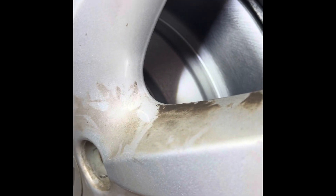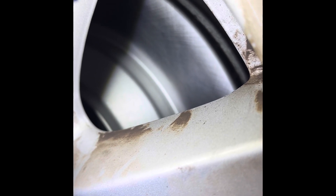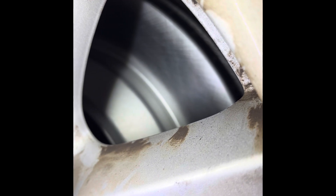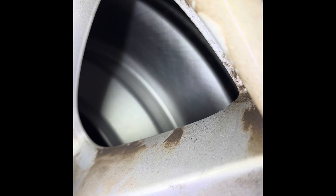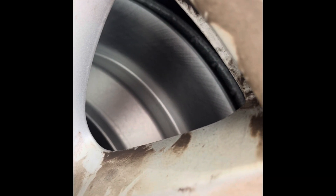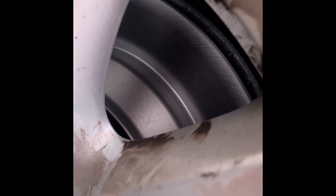I wanted to point out — it looks like they sprayed the hub gray, which is a nice touch, but they got it on the rotor as well. Just a heads up: when testing your brakes, if they sprayed on the rotor, the brakes are not going to stop as well as normal until you wear that off. After pumping them up it wasn't a problem for me — I was going down the road breaking them in. Some companies spray the hub to prevent corrosion. Cheers and happy braking — please subscribe.